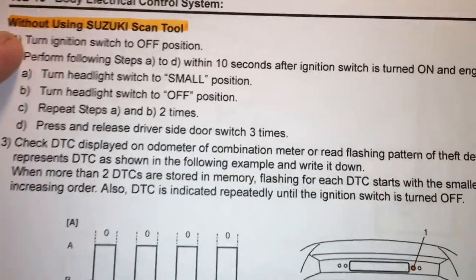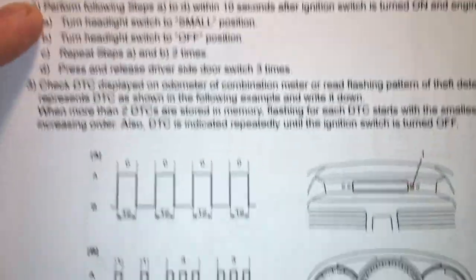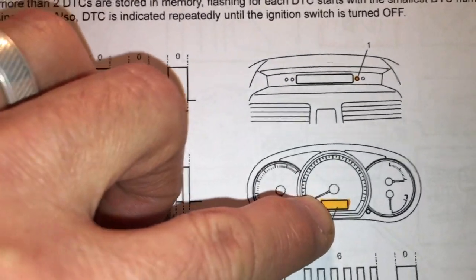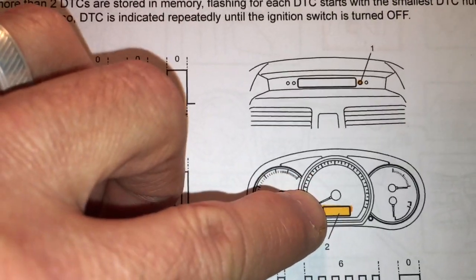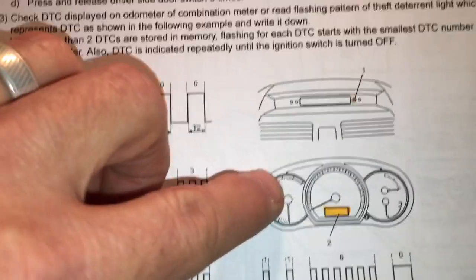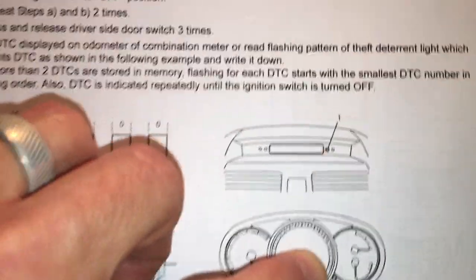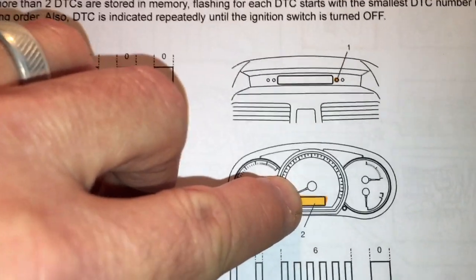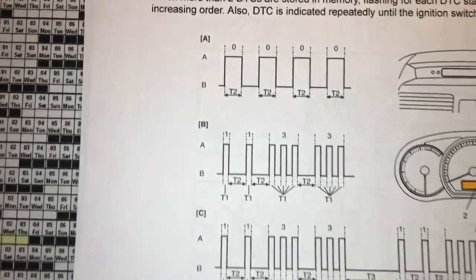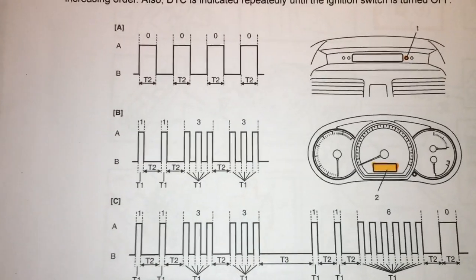Here's the procedure — you can read it for yourself. I'm going to take you out to the car and actually show you how you can do it. When you're out at the car, on the odometer on the instrument panel, it will bring up the applicable body code or U-code — network code — if in fact there's a fault. Quadruple zero will be displayed if there are no faults. A limited amount of U-codes and B-codes will be displayed. In addition to giving you the code in an alphanumeric form, it actually flashes the theft deterrent light in a sequence to show you the fault code — it's quite simple to decode when you see it in operation.